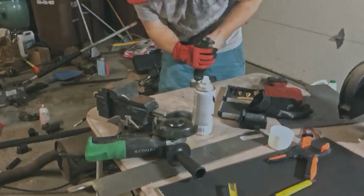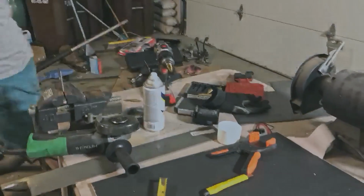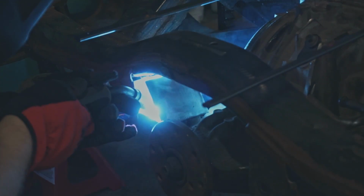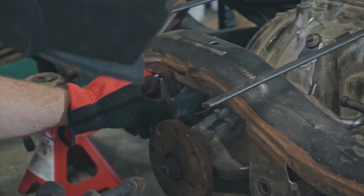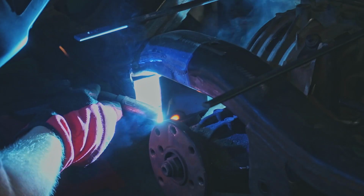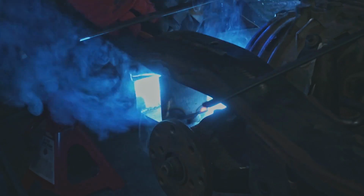After positioning the differential where I needed it to be, I went ahead and bolted a flat plate with a hole drilled in it to the diff, and then boxed that plate into the subframe. I was going to make a mount similar to the Subaru mount that had bushings on both sides, and it would just kind of rest up underneath there. But I decided to just weld a box onto the subframe with a fixed nut in the box. Worked out perfect.